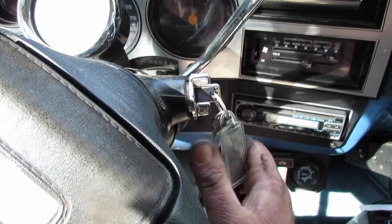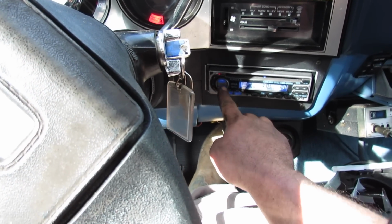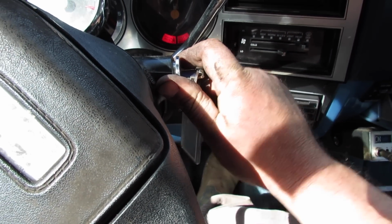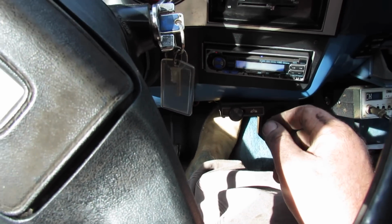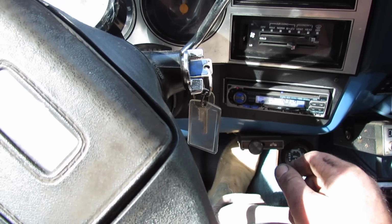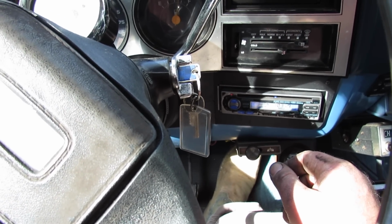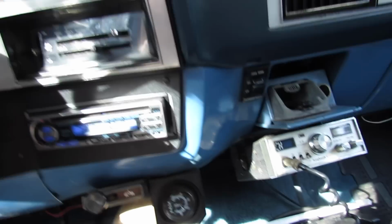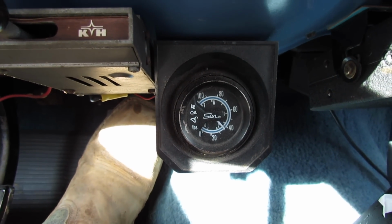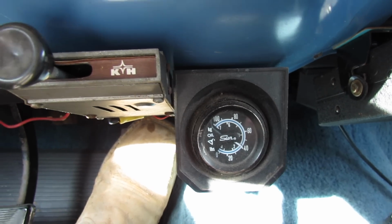Anyways, let's see if this junk will run. And if it does, you'll hear why I need to put a motor in it. Oh, gotta turn the radio off. Carolina cold start. It's like 50 degrees. It's got a squeaky belt on the alternator. Thing's got pretty good oil pressure. Pretty good. Not real great. But she's missing a little bit. It smokes a little bit. Burns oil. She's tired.